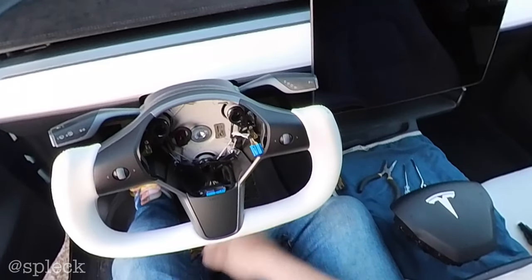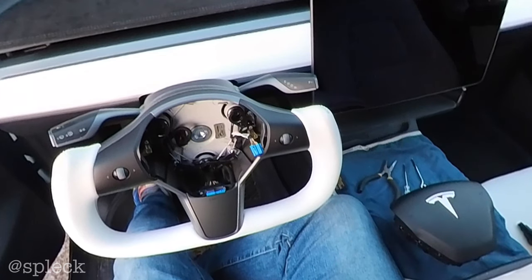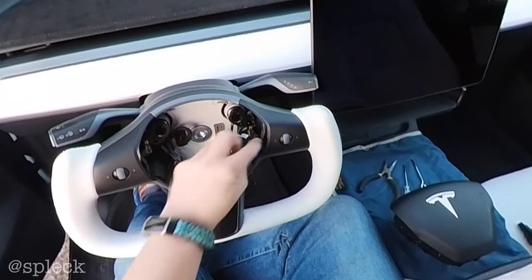There's a hole punch here and a hole punch here. You slide a screwdriver or small stick in there, and you'll loosen these springs right here and one right here that helps pop out the airbag. You unhook it with a pair of pliers and then you can take your pick, left or right.